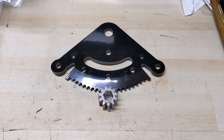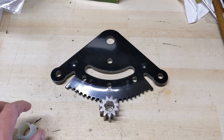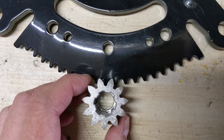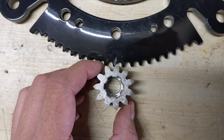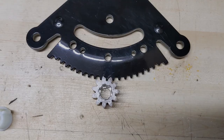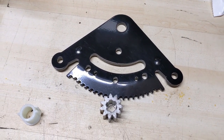Because the majority of these John Deeres are built the same they tend to run into the same issues, and one of them is going to be with these plastic bushings. Once the inside of that plastic bushing starts to wear out it allows the steering shaft to get play and you'll notice your steering shaft will start to wobble. However once that steering shaft gets enough play it will actually allow the pinion gear to start to move away from the sector plate, so when you go to turn, the teeth don't seat all the way in together and it starts to wear down the teeth of both the pinion gear and the sector plate. If your worn bushings are left too long you'll end up having to replace both the pinion gear and the sector plate in a steering repair kit.